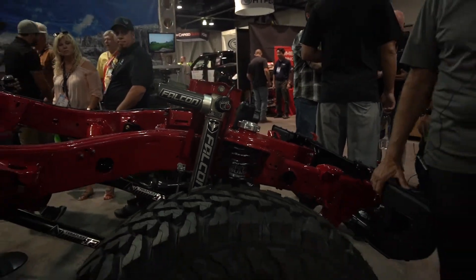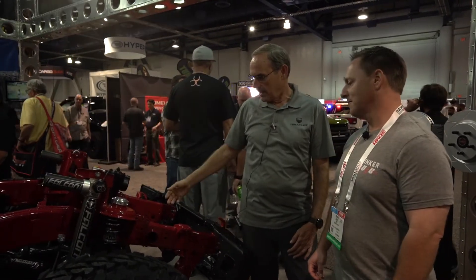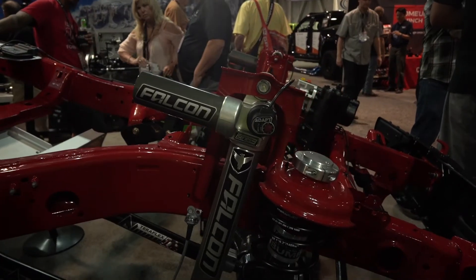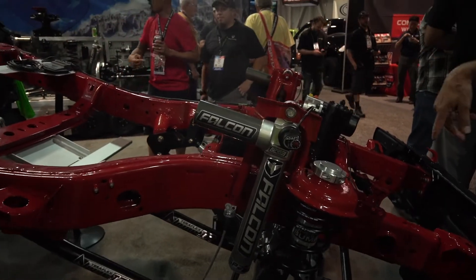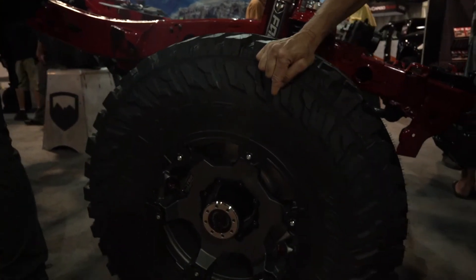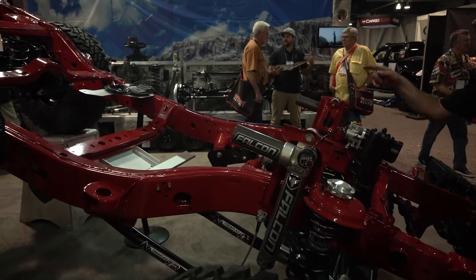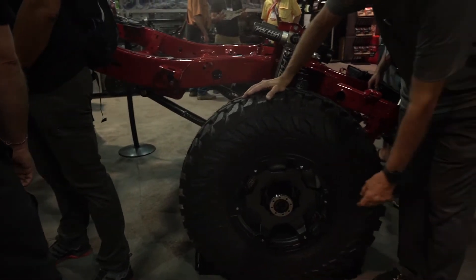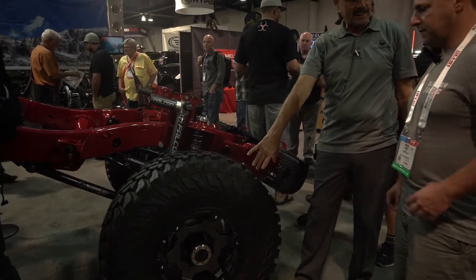Tell us what you have here. This is a JL frame — we just went out and bought one, just a frame, and then cleaned it up because the welds were awful. Up front, this is our Terra 60. We have the 60s front and rear under it. This side has got the full float eight lug, and the other side has got our five on five bolt pattern for a JK/JL. This is our Nomad wheel — you can open this up and drain it out, air down, fill it back up. We've got those for eight lug now — that's new for this year.